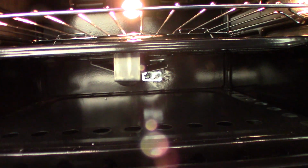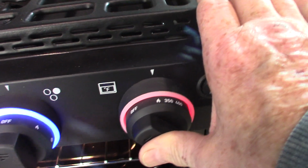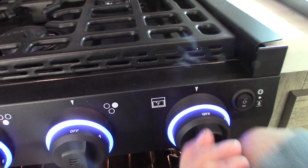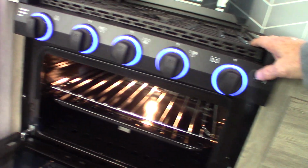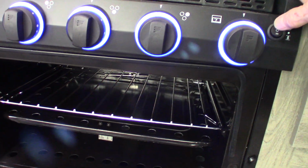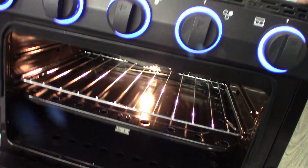When it comes to the oven, there's a pilot light back there on the bottom at the back. So you would go to the picture of the pilot light, depress it, keep it held, light it. Once you see the flame light, you still hold it for another 10 or 15 seconds to heat up the thermocouple. Then you go to operating temperature. When you shut it off, the flame goes out, but so does the pilot light. Okay, and then you have off here and on. There should be 2 lights. Just the blue light, the oven light, and then off.